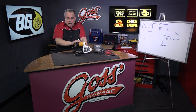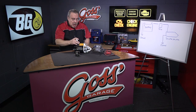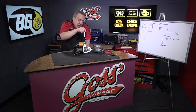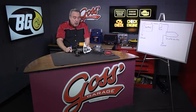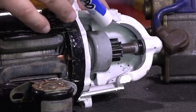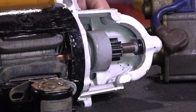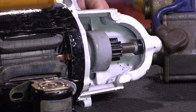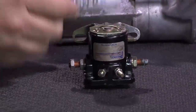The only ones that don't use a solenoid these days are some older cars. Let's define solenoid: a solenoid performs two functions — mechanical, to engage the starter drive, and electrical, to complete the electrical circuit into the starter. The other type used a spiral cut into the shaft of the starter with matching spirals inside the drive. So what had to happen was you made the starter turn, and because those spirals were cut in that manner, it would spin the gear out into the flywheel. In that case, we didn't need a solenoid — we used a magnetic switch or relay, such as we see here.